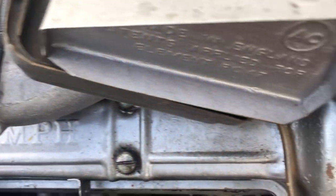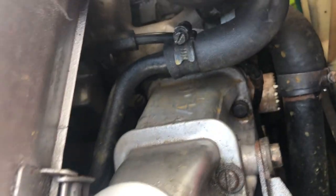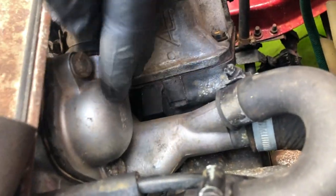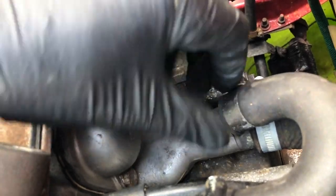That's good. The other pipe, as you can see here, comes indirectly through to the water pump via a metal pipe at the top of the engine, and then onto the water pump itself. If I just remove the air filter cover for a moment and the hot air pipe that comes up with it, you'll see there's a U-piece that comes into a fork on the water pump casing just below the thermostat housing, that gets the water from the pump and sends it through to the heater matrix, which then warms the car with a fan inside your car.